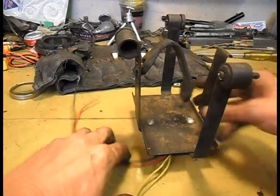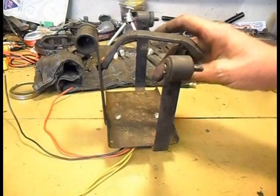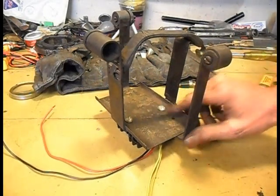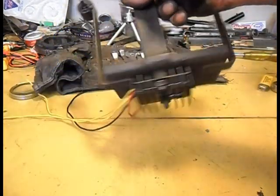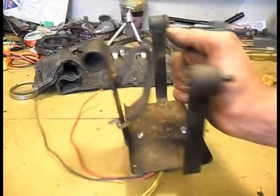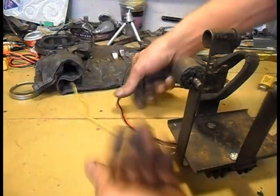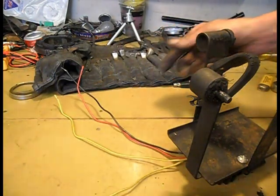Right, my Podtronics thing, I've just stuck it underneath the battery holder. I've used two coach bolts, so the rubber over that will protect the bottom of the battery. A couple of spring clips and just tighten it up, should get plenty of airflow there. So, see how that goes. Wonder what the green wire was they've chopped off. And then the wiring of this is fairly easy. Two yellow ones go to the alternator. Battery, and battery, or earth.